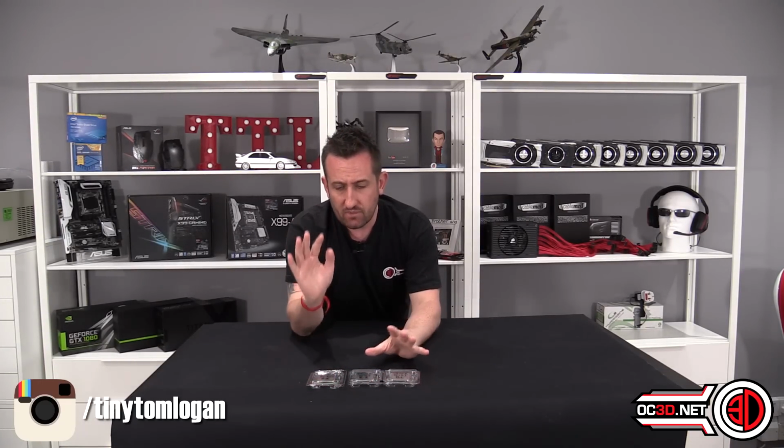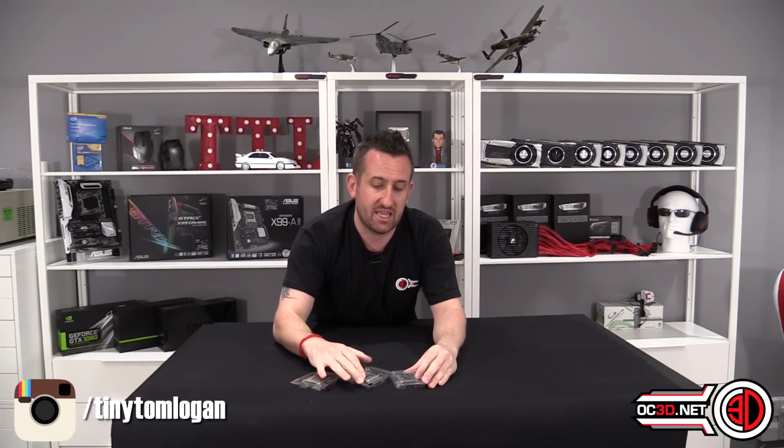But when I did my testing, and I will tell you this now, I actually turned off the Turbo Boost Max. So I only ran my 10 core at 3.5. The 6950X was 3.5, the 6900K was at 3.7, and the 6850K was at 3.6. Why did I do this? It was so that later on, when I go into testing the boards individually, we'll be able to see the differences there. And it gives us a really nice baseline.